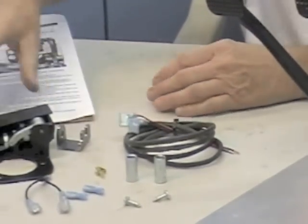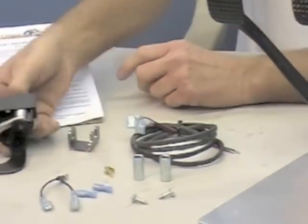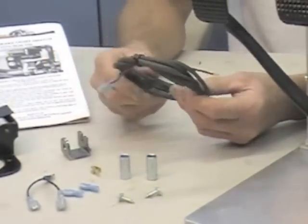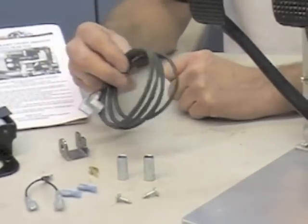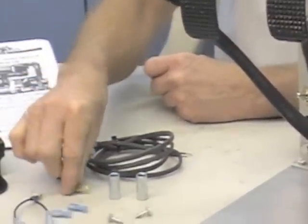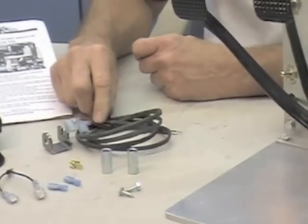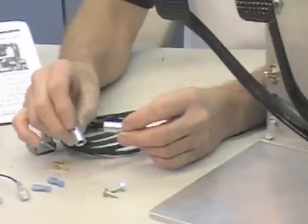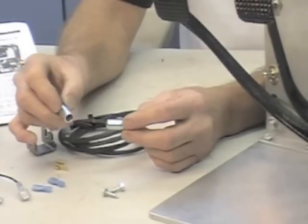Here's the way the kit is sent out. Here is your smart electric brake light switch assembly. It comes with a dust cover on the top and the interlocking actuator that goes onto your brake push rod. Also there's a wiring harness — the connectors are already installed. This is what will go from the switch up into your trunk area and then connect to your fuse panel. I've also included a piggyback connector and a pigtail connector, a couple of sheet metal screws, a couple connectors that go with the wiring harness, and the master cylinder barrel spacers. The factory insists that these barrel spacers be installed whenever you take the master cylinder off, so I've included these in the kit in case they've fallen down inside the pan.